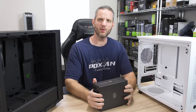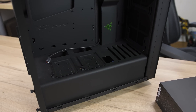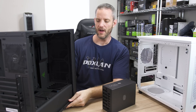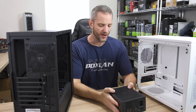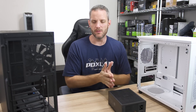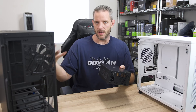So when would you mount it fan-down? Most people mount it down by default, and sometimes you're forced to, like in the NZXT case where a lot of cases implement a shroud to hide wires. When you have that shroud, you're pretty much forced to mount it down because the filtered intake is on the bottom and that's the only place it can draw cool air from — otherwise the fan ends up right against the bottom of the shelf and gets choked off. Many cases do have a stilt system where the power supply sits on thick feet with a gap before the case bottom, which prevents carpet from choking the PSU and also means it could still pull some air from inside the case.